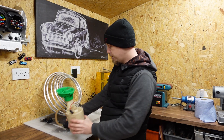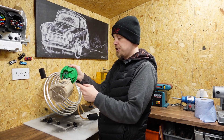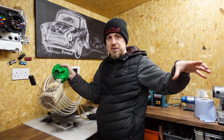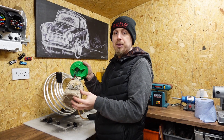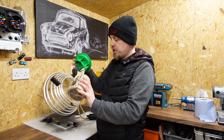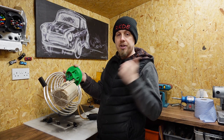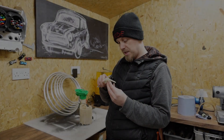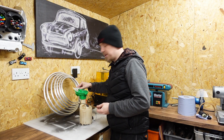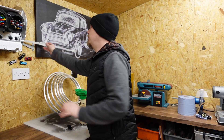There are a few other ways to do this - you could take your pump and feed out directly, because currently fuel is sent over to your fuel filter on the opposite side of the tank. I'm keeping that fuel system the way it is as I like the standard filters, but if you want to change it you could take the pump straight there and return fuel to the other side. We need about a 19mm hole; the spigot is about 10mm so there's plenty of room.